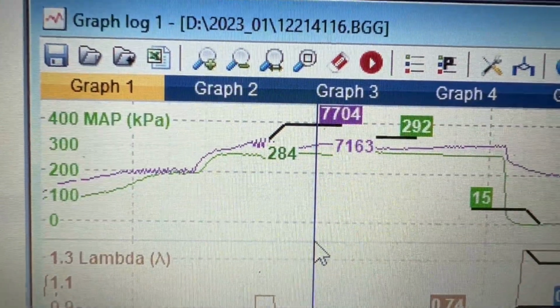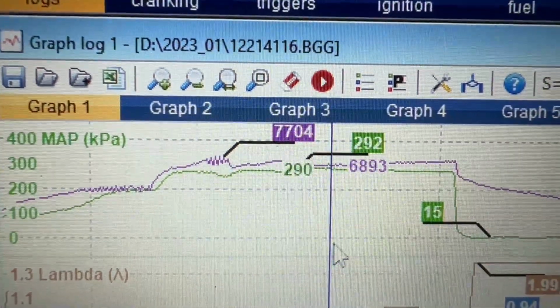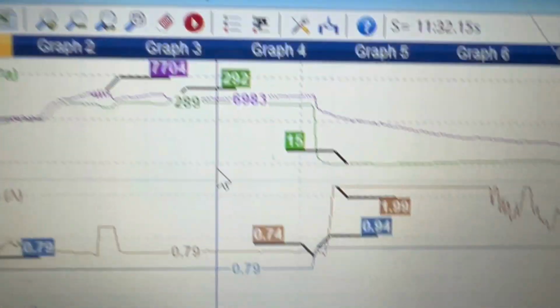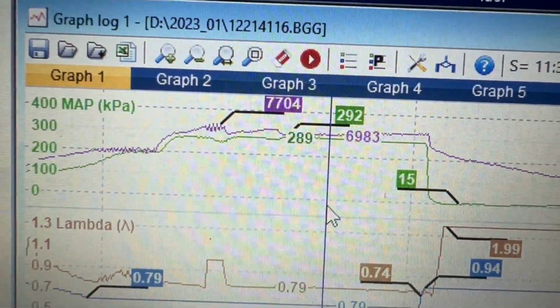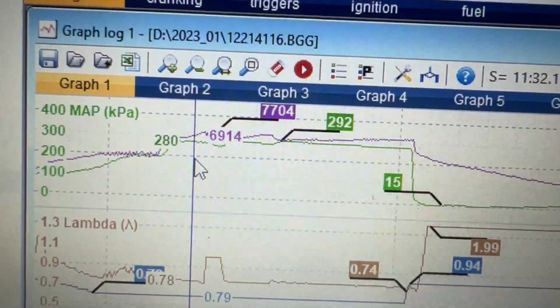And then it made 284 kPa up to 291. So it didn't make any more boost. But the weather got a little bit cooler, so that's probably why we went better on the 60. But we went 8.75 with it. So anyway, feeling pretty good about the way it went. And yeah, got to get those shifts better. I think that would have been a 5.38 or a 5.35 in the 8th.